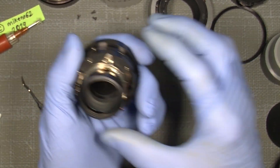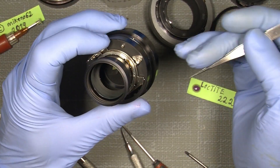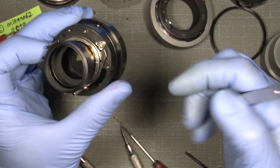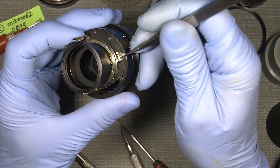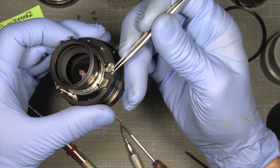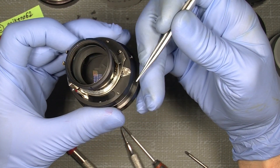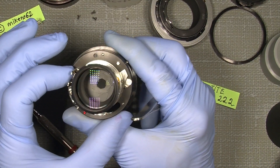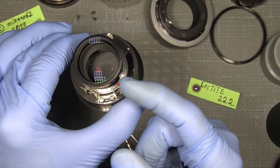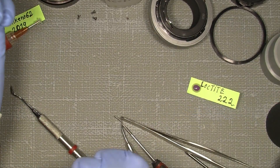But we need one thing which will make it work correctly. Because now there is movement when I turn here — it needs to actually, when I move this cam here, this part here should also move and actually open the blades. So I need to move the cam ring so the aperture blades move as they should. This pin — as they should. So that's good.